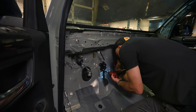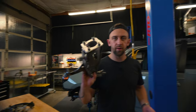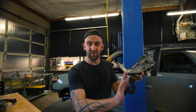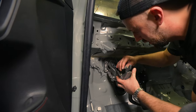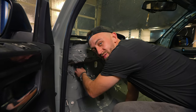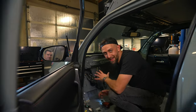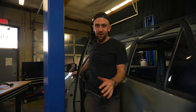Let's fit up the gas pedal - we know that's going to fit in there perfectly. This is the brake pedal out of a third-gen Tacoma. I'm hoping it bolts right up. This actually repositions the pedal to be a little bit closer to the gas pedal, giving you a little more room for the clutch. Maybe we'll actually be able to do some heel-toe action here. The clutch is going to be the fun one. Just to my knowledge, they don't make a 4Runner in a manual, at least one of the new ones.